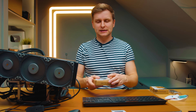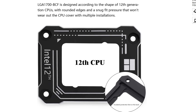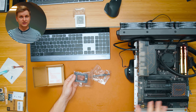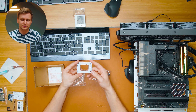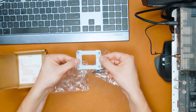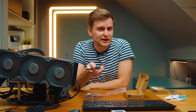Basically this is a contact frame for your 12th and 13th gen CPUs. How it works is very simple — you replace the actual contact frame or closing mechanism that comes with every Intel motherboard, and replace it with this bracket. Your CPU goes in there and this bracket holds it down, rather than the two metal clips. I'll show you when we do the change in a moment.